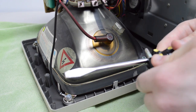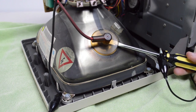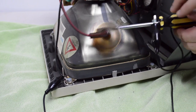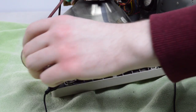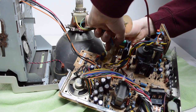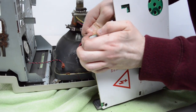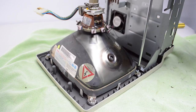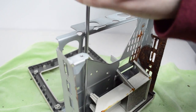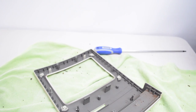Taking care of the CRT required the same precautions as before — and once again there was no spark, so it was all safe. I did manage to get the anode cap out in one piece, so all's well that ends well. After disconnecting more components I came to the yoke cable on the analog board, which at first wouldn't budge. After getting it out with some force, I noticed the connector had a burn mark — I wonder what caused that. Then came the CRT, and finally the rusted chassis. As I took the chassis out, something dropped on the floor — it was the battery.